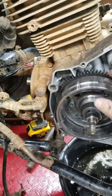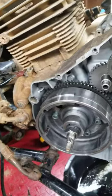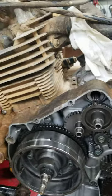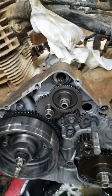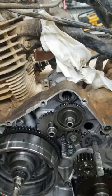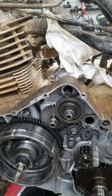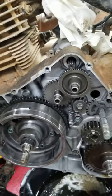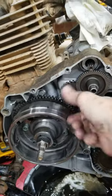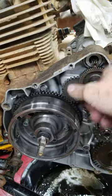So this is what I found — everything seems to be turning, but it appears to be the starter clutch on the back that's messing up. So if you have one and everything seems to be turning over, there's a good chance it's going to be the starter clutch. This is what it looks like, and this is what it was sounding like.